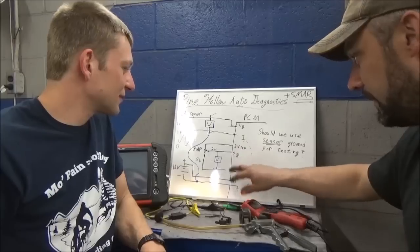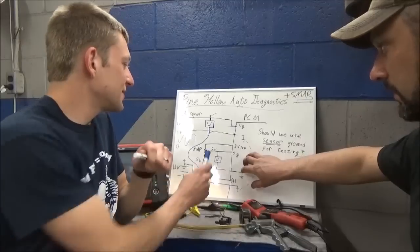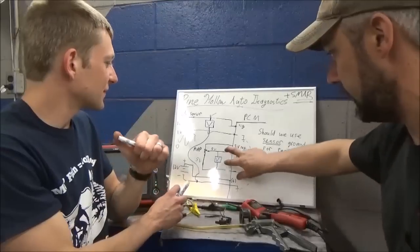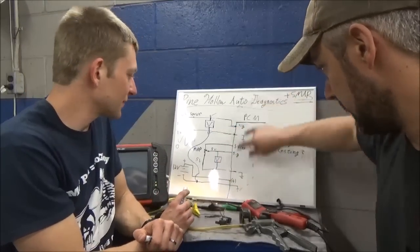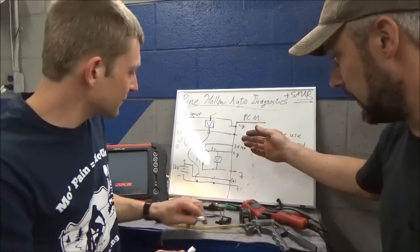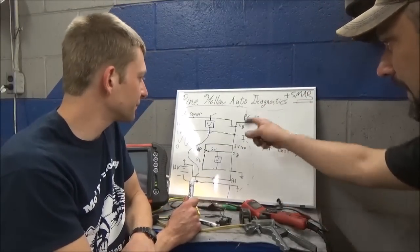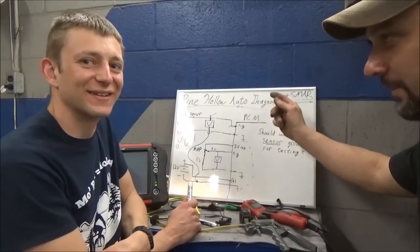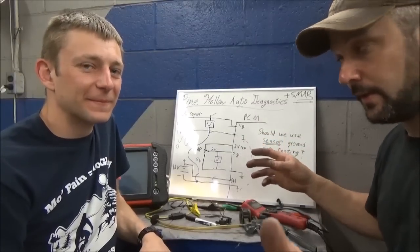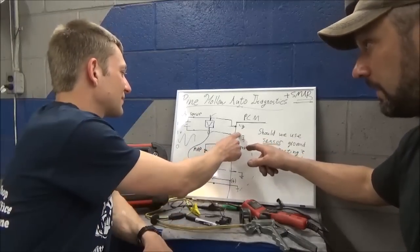In the case of the three-wire sensor, there's no way that can really trick you - you're going to see something's wrong. But for an O2 sensor, the moral of the story is you may not. Because this legitimately could break like this - the internal PCM ground could break. It's not a fictitious failure. It's plausible.